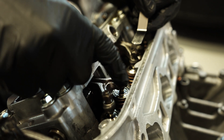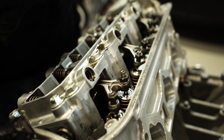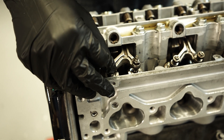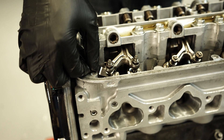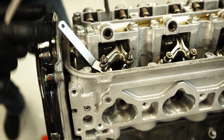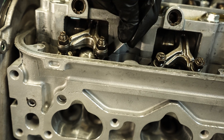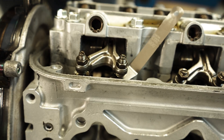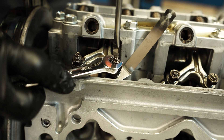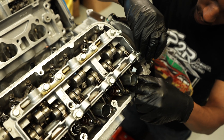On the intake side we're going to do 0.008 — that's what we're looking to get to, that's our goal number. You basically just want to start turning the adjuster and get the feeler gauge where there's a slight amount of drag. You don't want too much drag, you don't want it too tight where you can't pull it in or out — you want it to drag and hang up a little bit. You're going to use the flathead to keep the adjuster in place while you tighten your 10 millimeter. We're not going to over tighten it — at the end I'm going to use a torque wrench and get them torqued to spec. Once you do tighten it, go ahead and use the feeler gauge to make sure it still feels good.